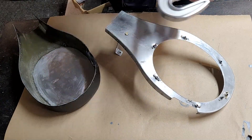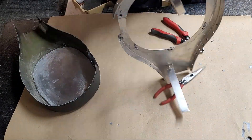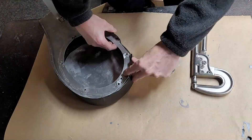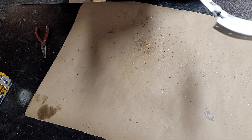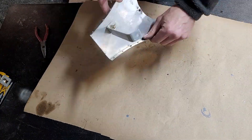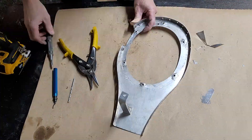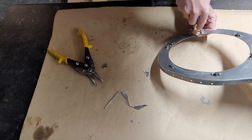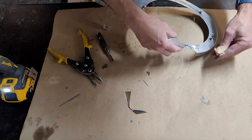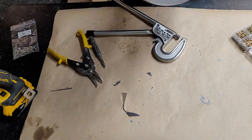Time to do some riveting. I'm going to fix a couple of the solid rivets that were holding on these screw anchors — these lugs that had come loose and weren't riveted properly. Those are now nice and solid. Next, I'm going to deburr all the holes in here, the rivet holes, because they were really not deburred very well when they were originally drilled — and I did end up nicking my thumb really badly while doing this. This tool is very sharp, so you've got to be careful. Next, I'm going to create a patch that's going to double up on that crack and rivet it in place over top of the crack to give it some strength and make sure it's not going to move in the future. It's not really under that much stress, but having this doubler there will help. I'll drill a couple of holes and then rivet it in using solid rivets on either side of that lug fastener, so the lug fastener and the extra rivets on either side are all holding that patch piece in there.